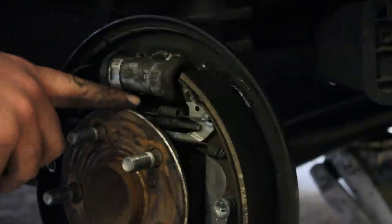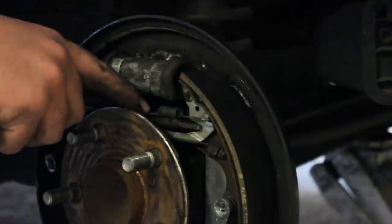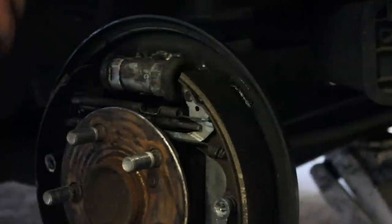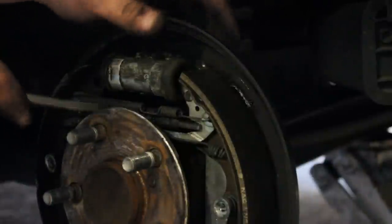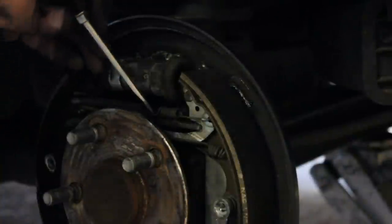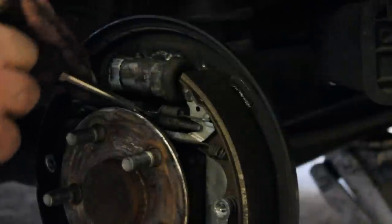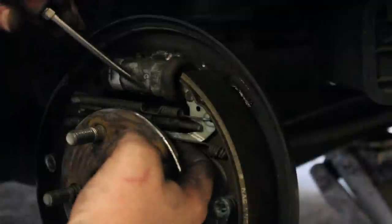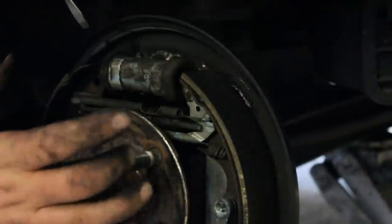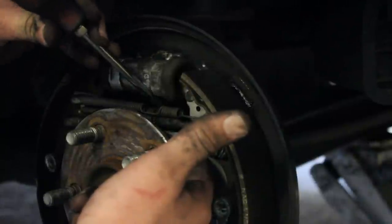On the driver side adjuster, left is going to loosen because it's going to drive this guy back in, and right is going to tighten your brakes because it's going to make this piece come back out. On the other side it's probably the opposite — just be aware of that and figure out what it is when you have the star wheel adjuster out. When you need to loosen it, you have to take your finger and lift up on this silver piece here because that's part of the self-adjusting process — it lets it tighten but not loosen. So you need to hold this piece to loosen, then bring it back down, and that will be loosening your brakes.